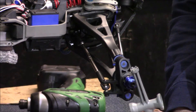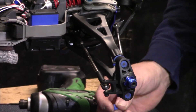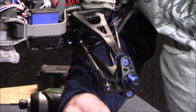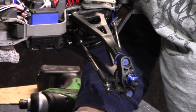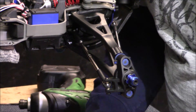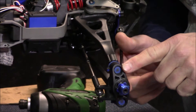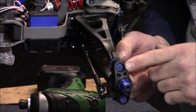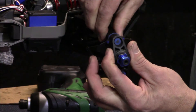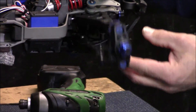Then take your tool and stick it right in there. This blue cap is just a dust cover that goes inside your pivot ball cap — you can remove it if you're having a hard time, but it does have a little slit in the center for the cam adjustment, and your wrench will also go over the outside of this blue rubber piece so you can do your adjustment without taking it out. Go ahead and turn that right or left until you get the correct adjustment, making sure you have a full range of movement. That's it on the pivot ball adjustment.